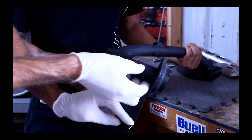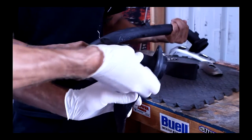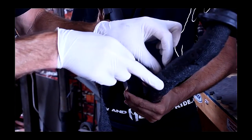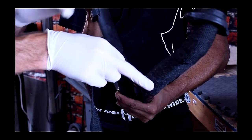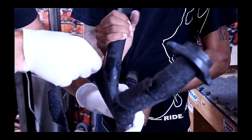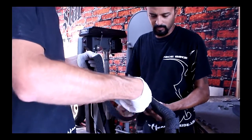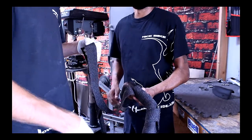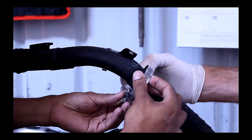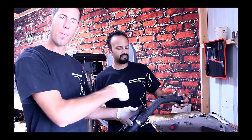Start off wrapping it around the top so it overlaps itself really well. It's kind of a two-person job — one holds the exhaust pipe and one wraps it around. Give it a good pull and an even overlap; about a half-inch of overlap is ideal so it looks nice and even. We've wrapped the front header pipe and we're gonna cut it here, stopping on the front header before continuing to the rear. We'll put a hose clamp on the end to hold the wrap so it doesn't unravel.